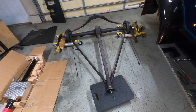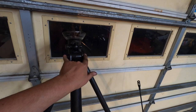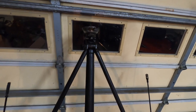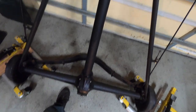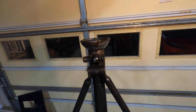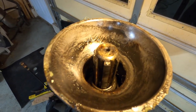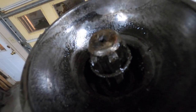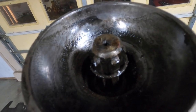Now that we have the axle stood up, the next thing is to take this bolt and nut off, then dig around in the goop to pull off the retainer that holds the speedometer gear in place, and after that we can start removing the torque tube. With that lower bolt removed, we come up top into the goop. The camera can just barely pick it up, but there's a spring clip down inside there that we need to pull off.